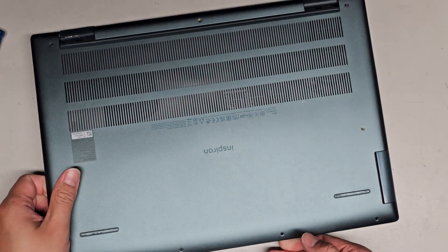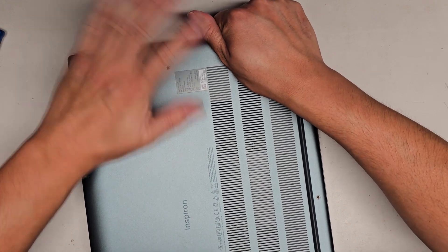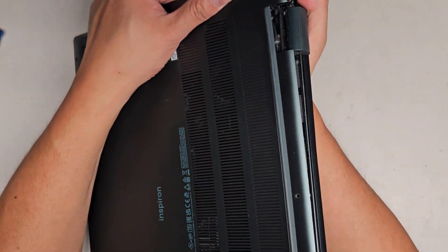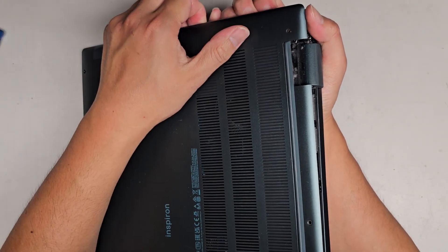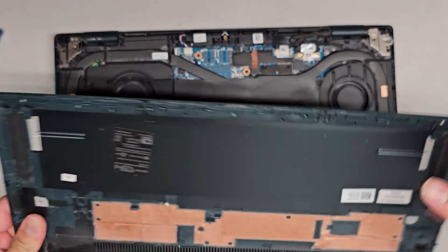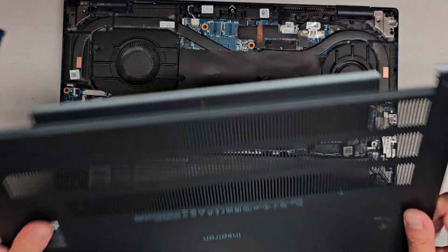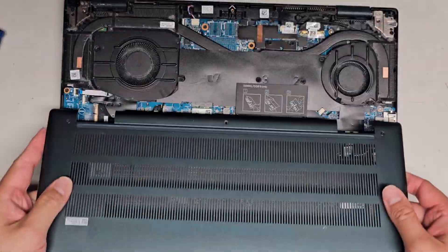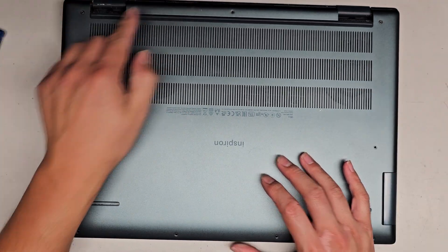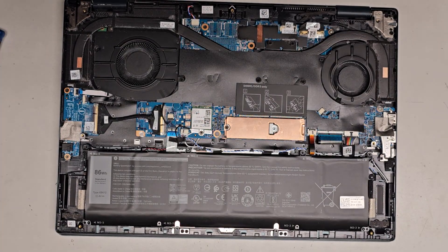The laptop turned itself on. I'm trying to flex it, but it's not even giving. I pulled the whole cover down this way and you can see it released. There we go — it released the top and now we got this. Here you can see the clips — they actually hook into this, so it needs to pull this cover this way to pop it out. I guess if you use a good tool, you can wedge it and pull it that way.